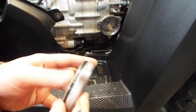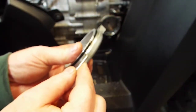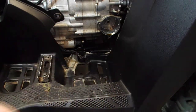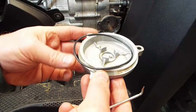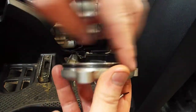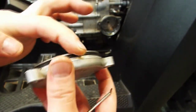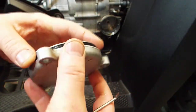We'll go ahead and take this old O-ring off. We'll use our Harbor Freight special — just get under it and peel it off. And we'll put the new one on. Just like that. And you want to make sure you coat this with some oil so it goes on easier. Just take a little bit from there and put a light coating of oil on it.